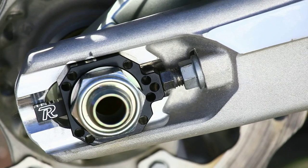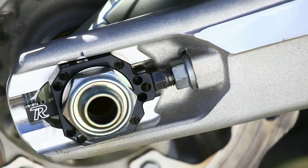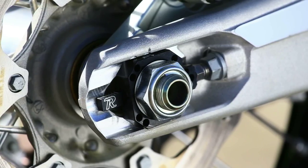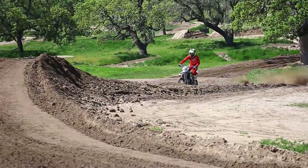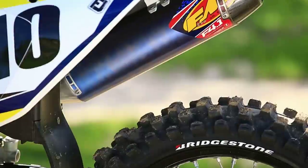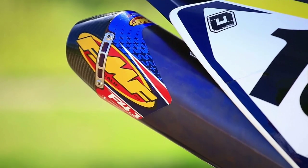Staying on the back of the bike — our axle and axle block kit is something unique from Ride Engineering. We use our own axle blocks which have little serrations to make chain adjustment easier, combined with a Honda axle. The reason we do that is we want the left axle block to float, not be attached to the axle like the factory one. We also added an FMF exhaust system — this system took almost three pounds off our bike.